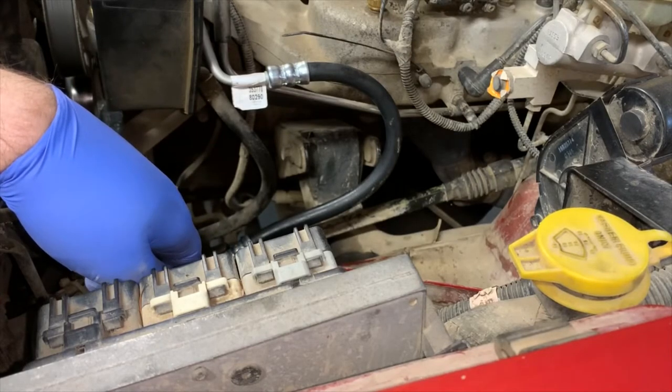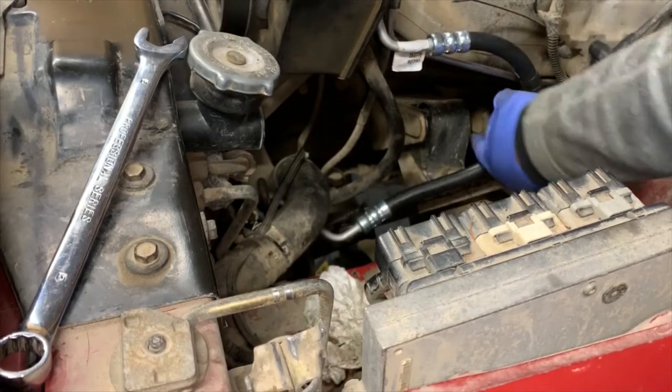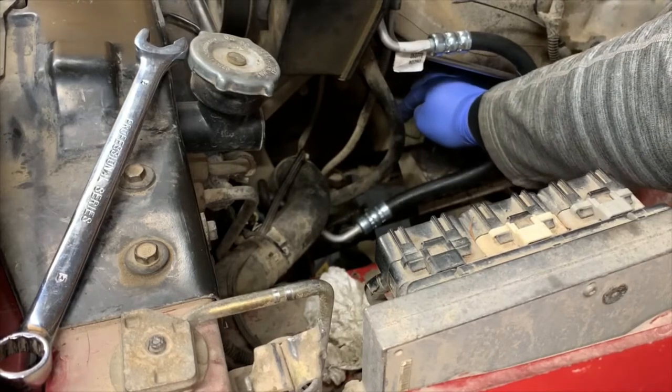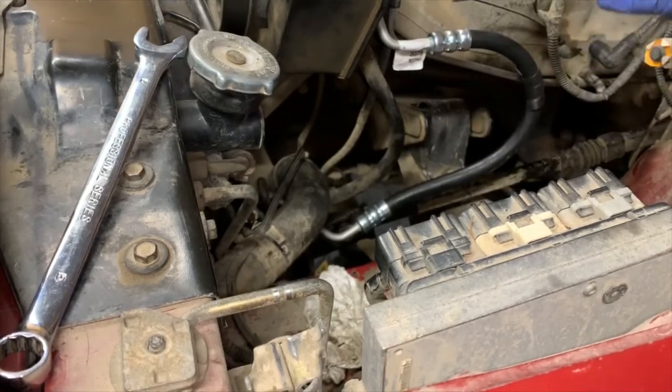Anyways, now to get to the fun of this. In case you're wondering with the motor mounts, not on this end, I believe it's an 18mm, 18mm, 13mm, and I can't remember what it's underneath. I think it might be a 15mm, but I'll let you know, just so you can have the right tools ready. Now keep in mind, loosen this and your engine will fall, or be supported by your exhaust manifold and crack your manifold. So let's not do that.